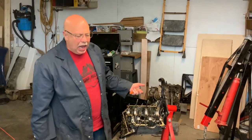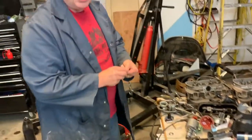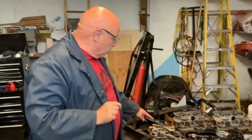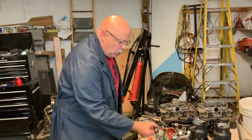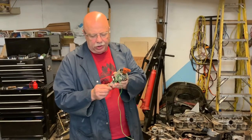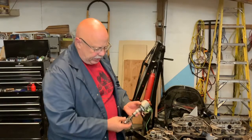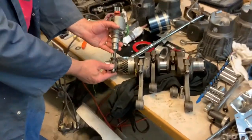What on earth could go crunch? I want to show you the problem. The motor didn't have this little spring — when I pulled the motor apart it was never in there. The groove for it was full of gunk, so I know it hadn't been in there for a long time. That's quite likely why it hadn't been driven much. Whoever last put it together didn't install that spring. It holds this gear in place, and this drives the distributor cap which controls your ignition. It feeds off this gear off the crank.